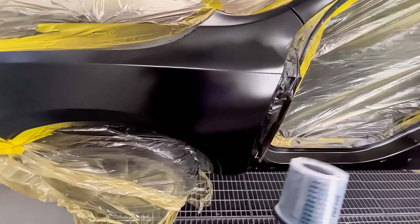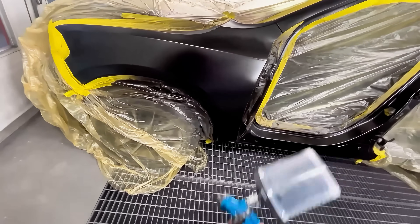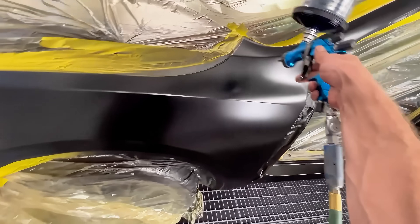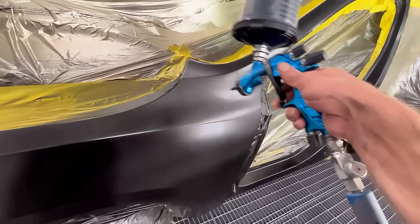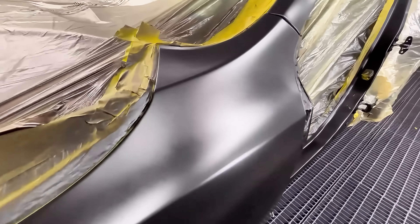Looking back, that was one of the greatest lessons he ever taught me, and I have a perfect example of why right now. We have two coats on here and you can see our sealer edge right there. Not using a regulator puts you in a position where you have to experiment a lot with your pressure. I wouldn't know that I can drop down my pressure, let the material come out nice and chunky, and smooth out that edge. Right now I'm at 10 PSI — I'm going to go directly over that sealer edge. Look at how thick that material is coming out, and just like that our sealer edge is about 90% gone.